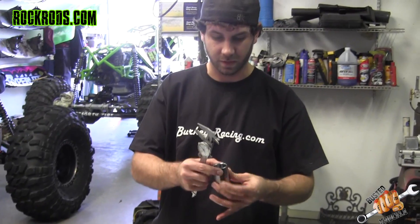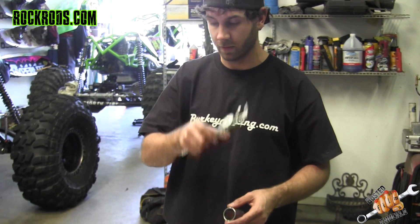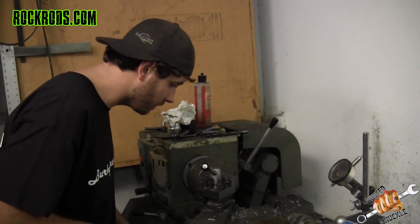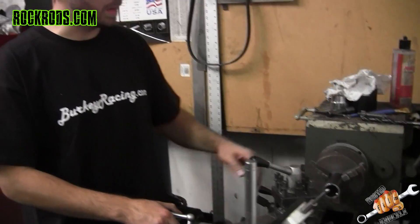I'm going to take a piece of tubing, put it in my lathe, and cut it so that it's an inch and a quarter longer — it'll sit on that shaft and limit the amount of travel this bump stop has. I took a piece of inch-and-a-half 120-wall outside diameter DOM tubing and cut it to the length that will subtract the distance needed to make those bump stops two inches. Now I'm just truing up the outsides to make it nice and smooth.